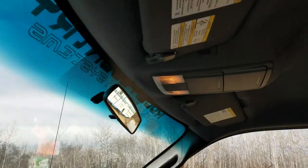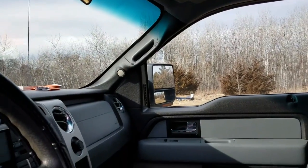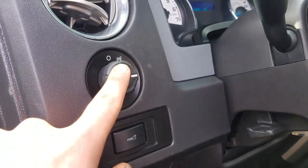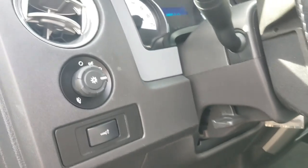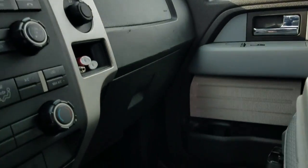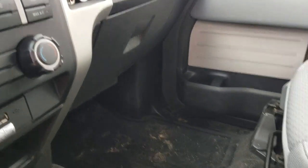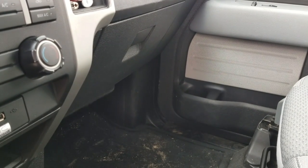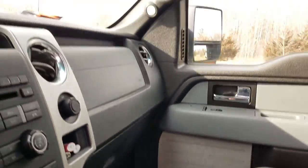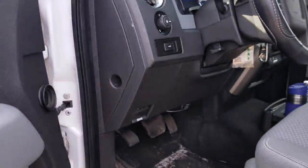I could not end up tapping in there — the wires were too small, there wasn't enough power, and there's a sticker that says don't tap into these. What I did instead was go into the fuse panel. I used my voltage meter identification light, found a good accessory wire, split into that, and then grounded it up in the pillar — there's a ground bolt there.